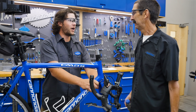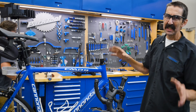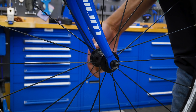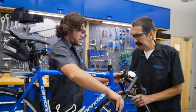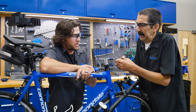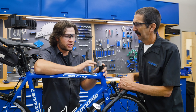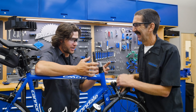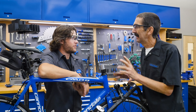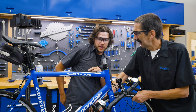We are hitting our head against the wall at this point. I'm just comparing pipes here, that's all I'm saying. At this point, more fun to be had. So I'm going to go back with the wheel a little bit here for a little more leverage — we're going to come in with some destructive force. One thing we want to mention quickly is our friend heat. Heat expands things, which could work — not so great here with carbon. Carbon is pretty stable, doesn't expand or contract too much in different temperatures. You're going to run into issues because the one thing you want to shrink is going to get bigger. Some cold — put some dry ice — that's thermal dynamics kind of stuff. So we're going to twist these spacers off. I've got some leverage here, and I'm applying some thin lubricant to help get it down.